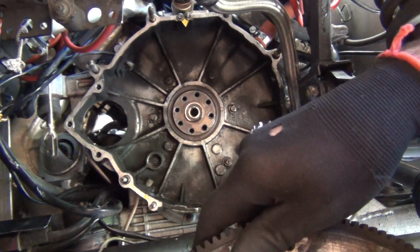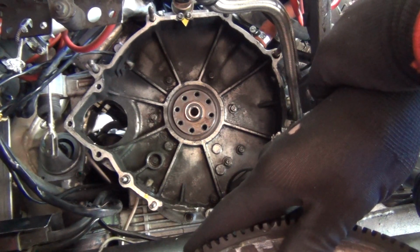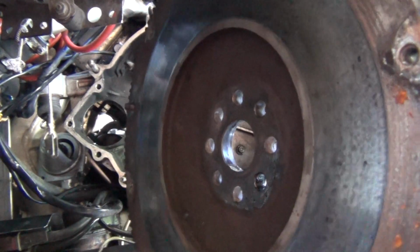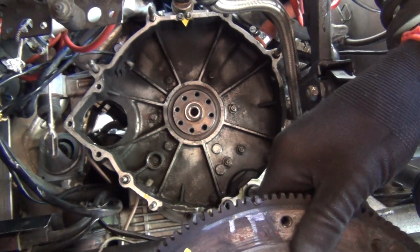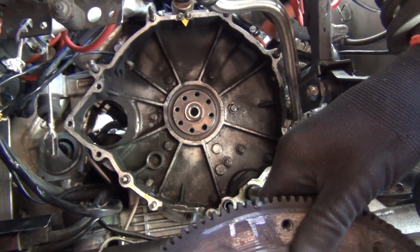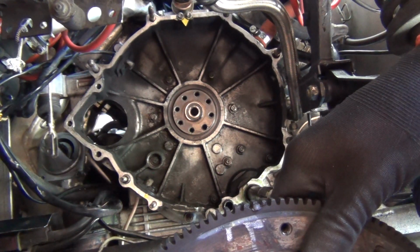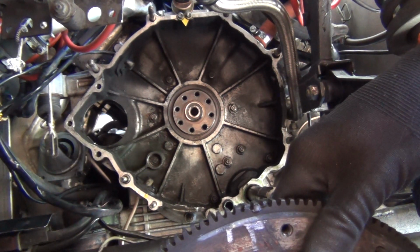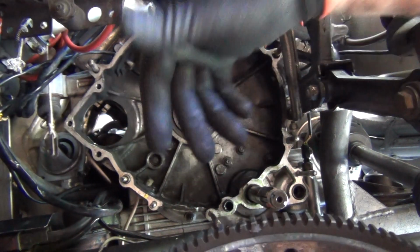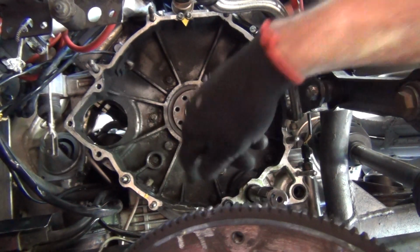Rear main. Wow, I'm not sure, is that bearing supposed to be sitting proud like that, sitting slightly, if you can see that, in there? I'm replacing that pilot bearing anyway. I'll probably remove it while the sandwich plate is still there, just so I've got something to brace my puller on. I've got a special puller that should do that job, I hope. But anyhow, you can see down here, there's oil down there.